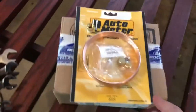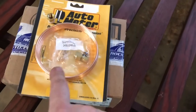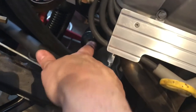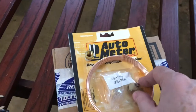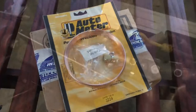Now for that Auto Meter kit for oil pressure — this is a kit for mechanical oil pressure, where pressure goes up the tube to the back of the gauge. For Fox bodies they have an electronic gauge and sensor. I already loosened this with a 9/16 wrench — took it off. You can see where we're going to put the oil pressure tube; a compression fitting will go in there and run up through the firewall.